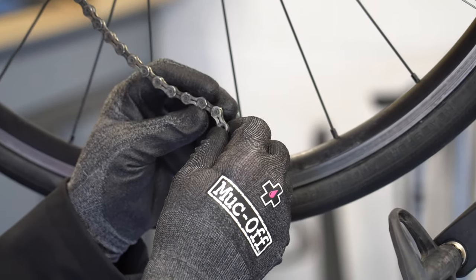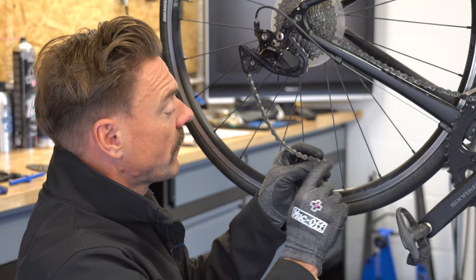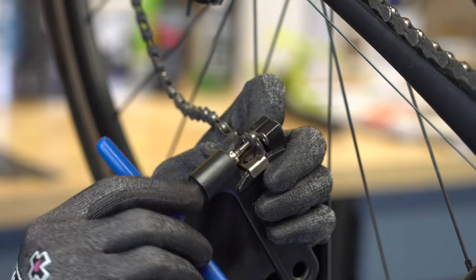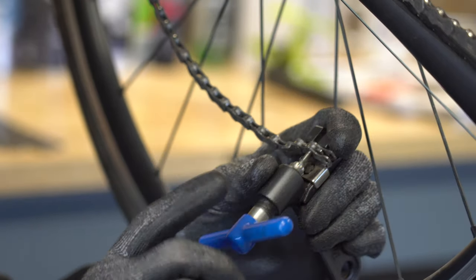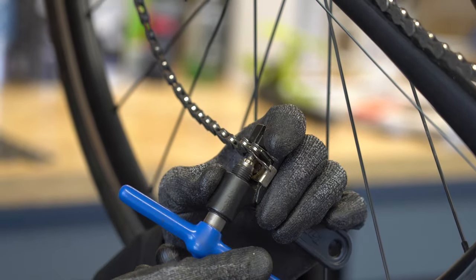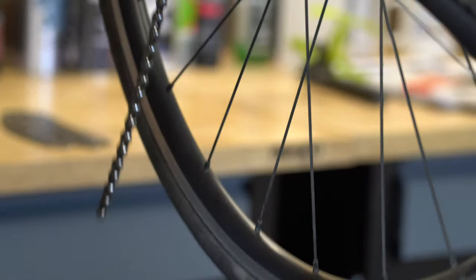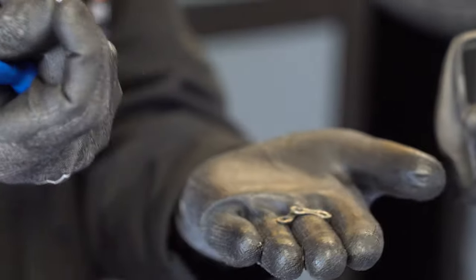Using the chain pin remover on the end of my multi-tool — though I'm going to use my workshop version — we're going to take that off and clean this end up ready for repair. We slot it over the top of the anvil section, drop the chain in, and start driving it forwards making sure it's lined up. Give it some force, and you can see I'm driving the pin out of the back. And there we go — those two loose chain plates have come away along with the pin, which I no longer need.